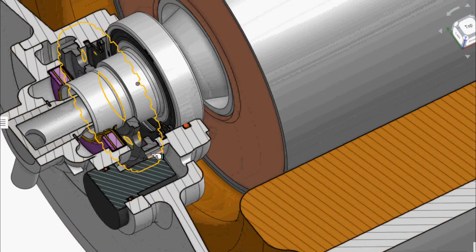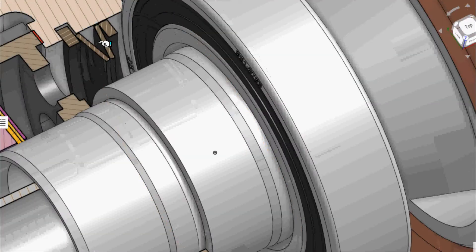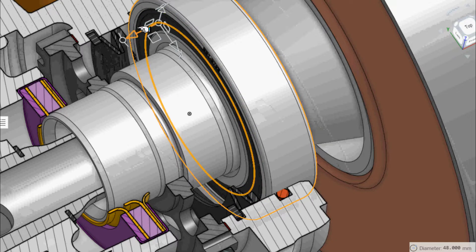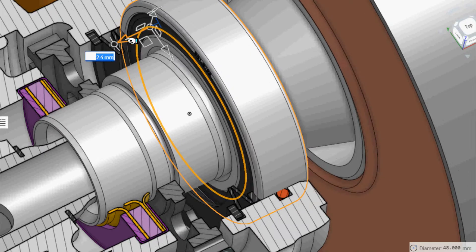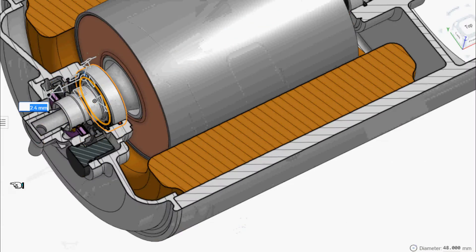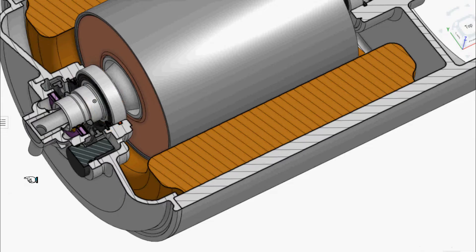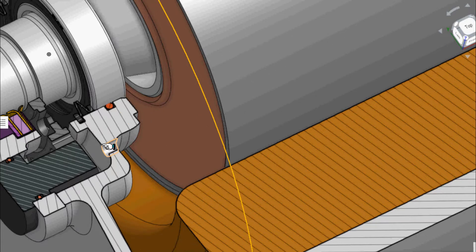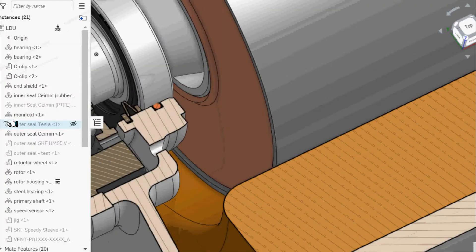However, the maximum possible spring displacement can only be achieved when the car undergoes lateral accelerations of 12g — even Formula 1 cars do not reach that unless in a crash. More realistically, just below 1g, displacements are less than 1 tenth of a millimeter, so I think we do not need a large hole. This leaves pressure changes from thermal expansion. These changes are generally very slow, with a time order of magnitude exceeding 1 second, meaning the airflow rate through the hole is also very low. So I'm going to close the hole and add a watertight membrane breather instead.